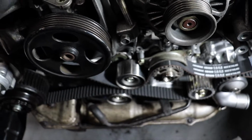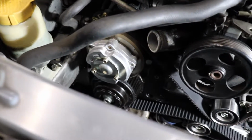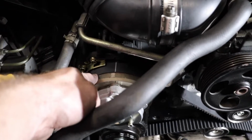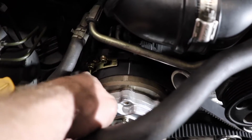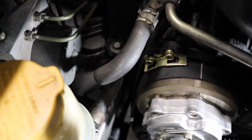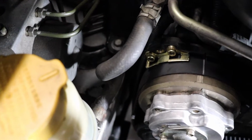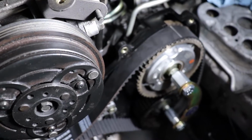And you're going to go to the passenger side first, wrap around. What you want to do, a little strategy, is as soon as you do get the belt in place, lined up with your marks, you do want to put the little belt holder here, the little retainer that keeps it from popping out. That is built in to keep it from coming loose if you ever stall the car. There is one of those on every single cam except for the last one you're going to do, which is the top one over here on the driver's side of the vehicle.